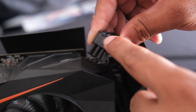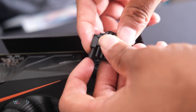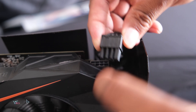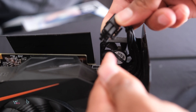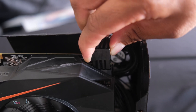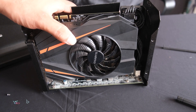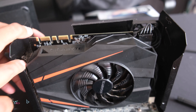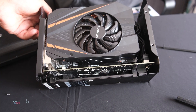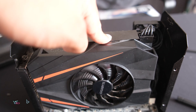To recap: take the power connector, press it onto the other one, and press down. There will now be no gap. Press the power connector in, and the latch should be towards the back of the graphics card. Once you have the graphics card installed, as well as the power connector, double-check that it's in correctly on the PCIe 16x slot. You now need to press the plastic bar down again — it's not exactly necessary, but it will keep things in place while in transit.